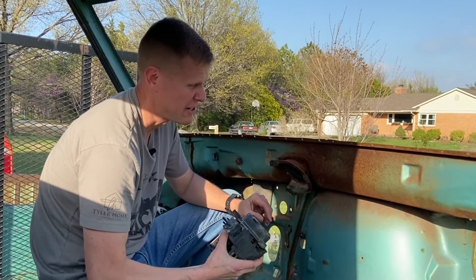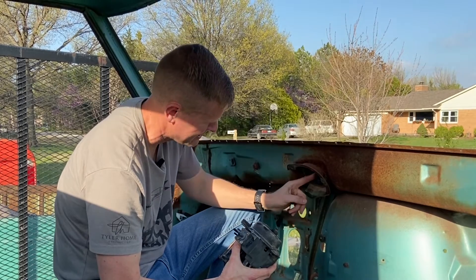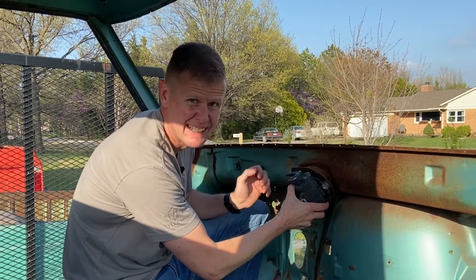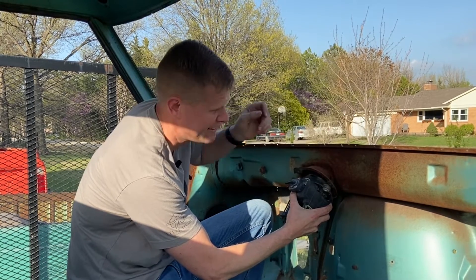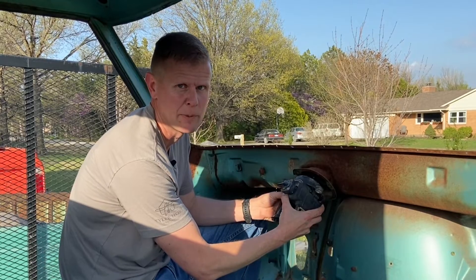When you go to reinstall this, you're probably going to have to have somebody from the outside sticking a screwdriver down on that rotating arm because it's going to be real wobbly in there and hard to get it to mount back through. So once you get that wedged on there and someone's pushing a screwdriver down, hopefully you can get your fingers back in here to get that nut on and then tighten it with a wrench.